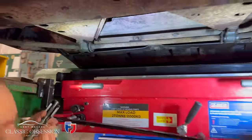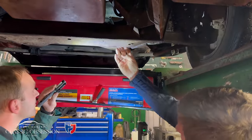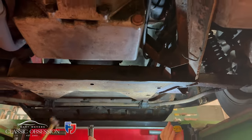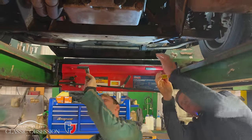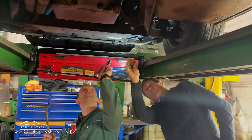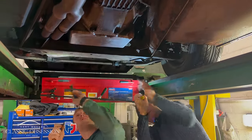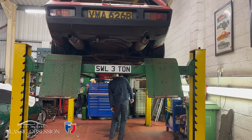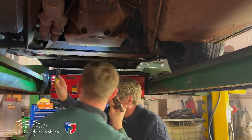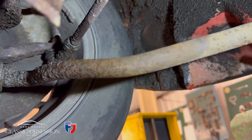Sometimes when you spend a week buzzing the bar off and painting it to look nice, it's probably best just buying a new one. The chassis at the front has just got surface corrosion. I'm surprised — I thought these would be rotted through, but all the wells are intact and it all just looks like surface rust. There's a little bit of a leak on the rack, but the track rod ends actually look new, even though the rubber looks like it's been on a long time.